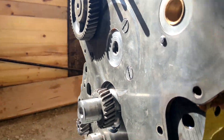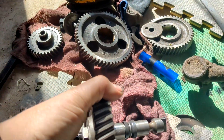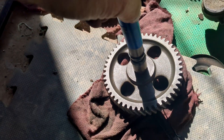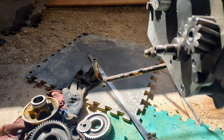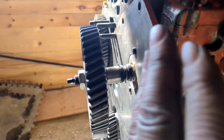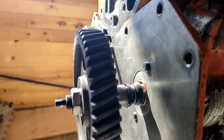What I've done here — you can pull that injector pump off with this front end together — and we've got new umbrella seals here. They make a special tool, but what I did is I just made my own tool to slide those umbrella seals up and over their grooves that they sit in. They make another tool to compress that seal, but I think I'll be able to get it in there just fine since I'm working from the front end instead of the back end, without spending the money on the tools.